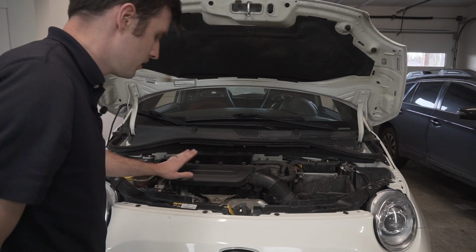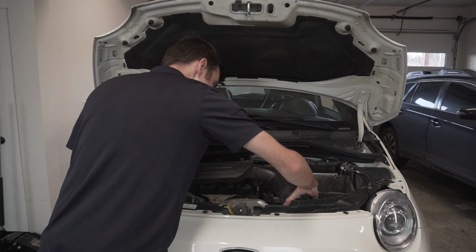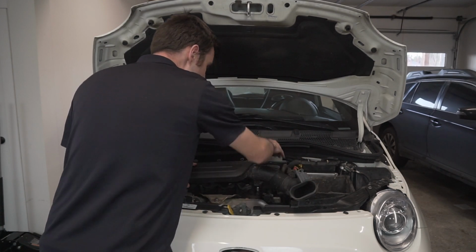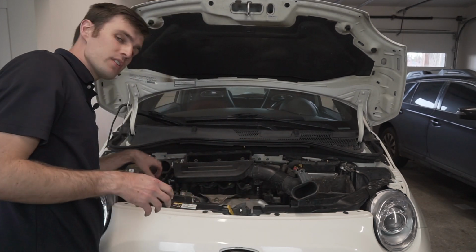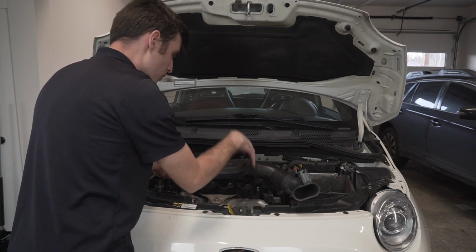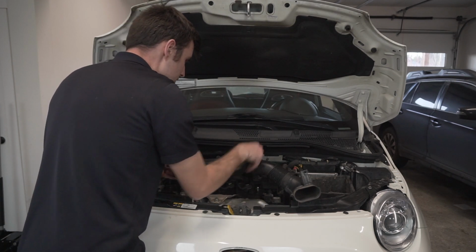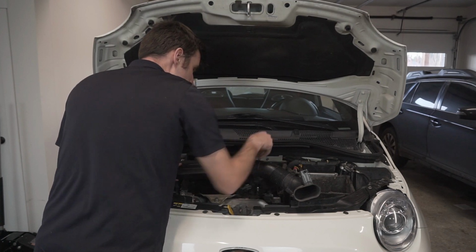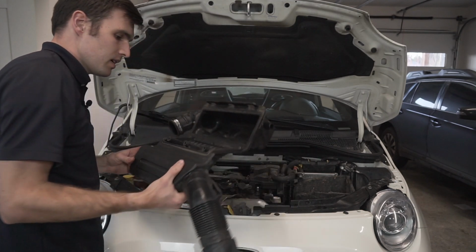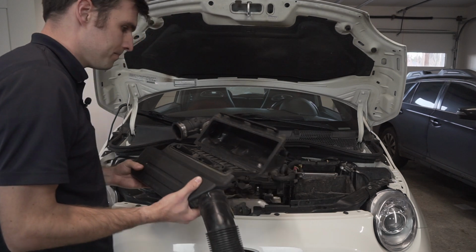This guy right here comes off. One 8mm bolt right here. Slides this out. Then, as I mentioned, I already took this part off. This guy, I already pulled it up, but it basically has 4 spots where it kind of just snaps into place. And so you pop those 4 spots off. You'll need to take this hose off, but then this guy just lifts right out. And that's the air assembly. So I didn't have to take that apart too much to get it out.